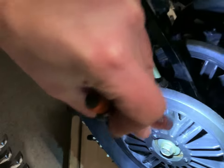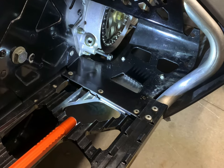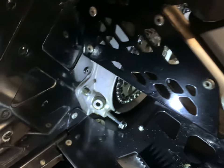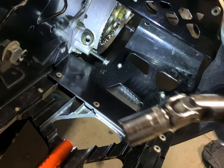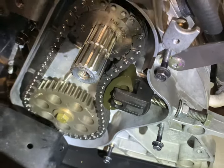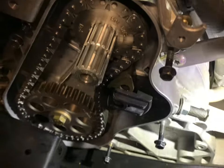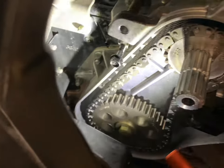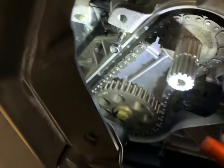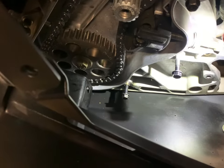The first thing you're going to want to do is actually loosen up your axle — it's a 15mm nut and socket. With the sled lowered on the ground so it shouldn't go anywhere, if I run my torque wrench on that it might move the sled, so I might have to put a bit of tension on the running board. It's a 17mm socket with a swivel head — torqued to 29 foot-pounds. I tied in my chain tensioner, just cranked that in with my finger as hard as it would go, then backed it off about a quarter turn, which will get you about a millimeter of play on the backside. They call for 22 foot-pounds on that tensioner nut.